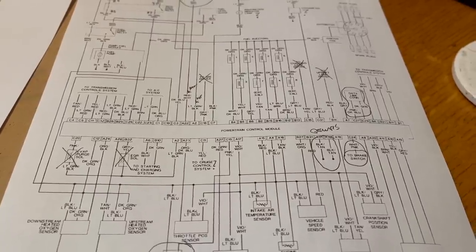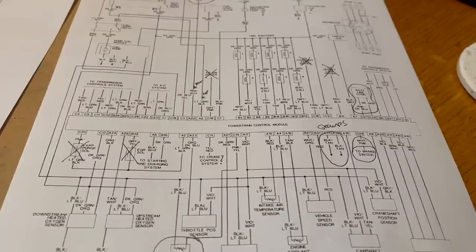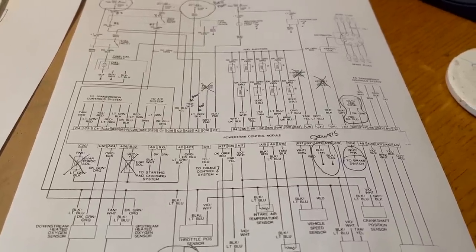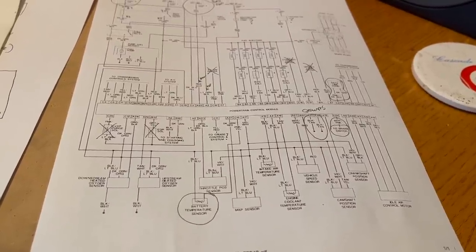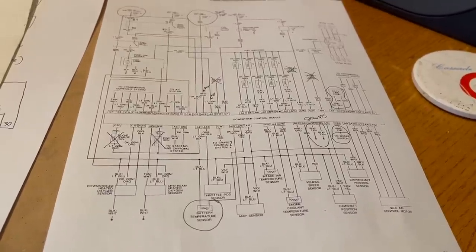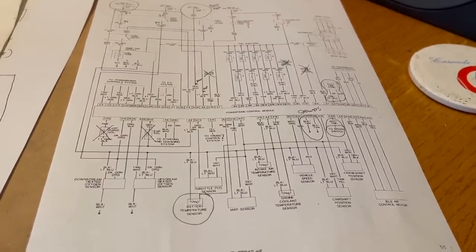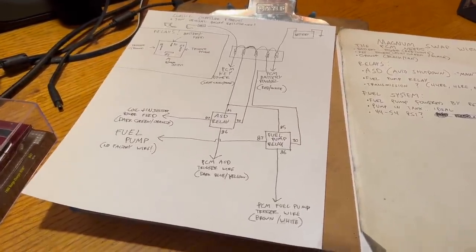There is no relay control wire shown on this diagram. I believe for the transmission relay, you simply need it to be key trigger, meaning you would ground out pin 86 and just have another key power wire going to 85. The output for the relay isn't on here either. In the harness from my 2001 Ram donor vehicle, that wire was plain red. Your mileage may vary on that one. There might even be another red wire. So you'll want to verify that it's going down to the transmission. But what it does is enters the transmission and powers all the solenoids. You definitely need it. I've championed this swap for years, and this is why. I mean, what do we got here?